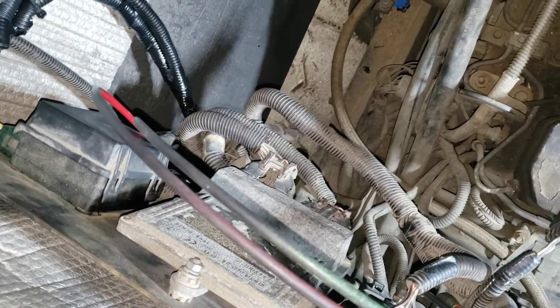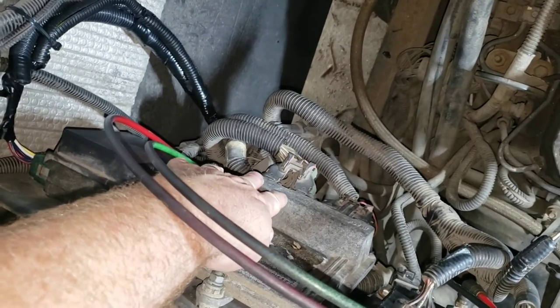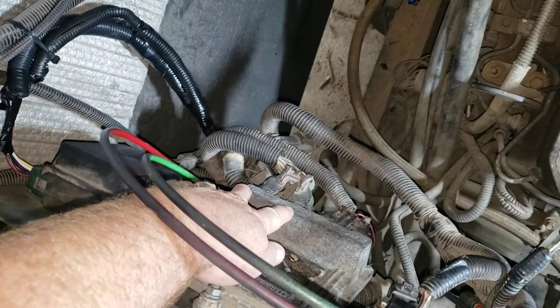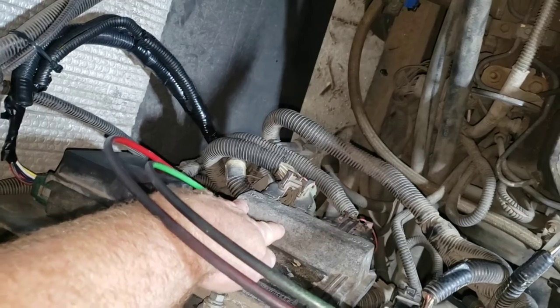At this point, that was huge. Well, it wasn't zero, it was really low. It was around 10 to 11 volts, which is not right. It's supposed to be 12.6. Furthermore, I used a test light on each of those pins, and it's supposed to be a full-blown 12-volt signal, I could not get a test light to light.